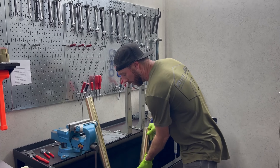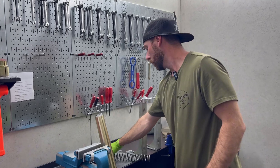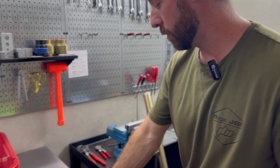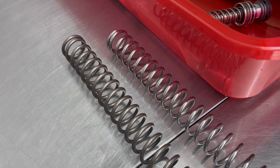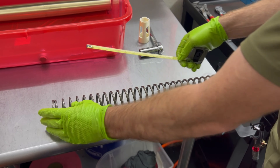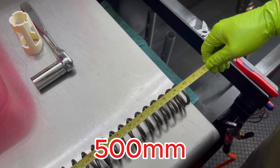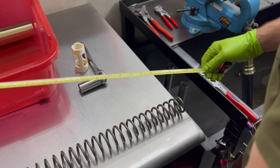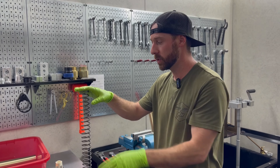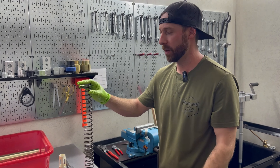Next we have the new fork spring, which Honda talked about. So let's pull this out. Here's the new spring — at first glance it looks pretty identical, but let's lay it out on the table and give it a measure. The previous springs have been 475 millimeters long. Let's see what these shake out to be. Looks like they're about 500 even. So they have increased the length of their spring by 25 millimeters. If you're an SAE guy, that is pretty much an inch minus 0.4 millimeters.